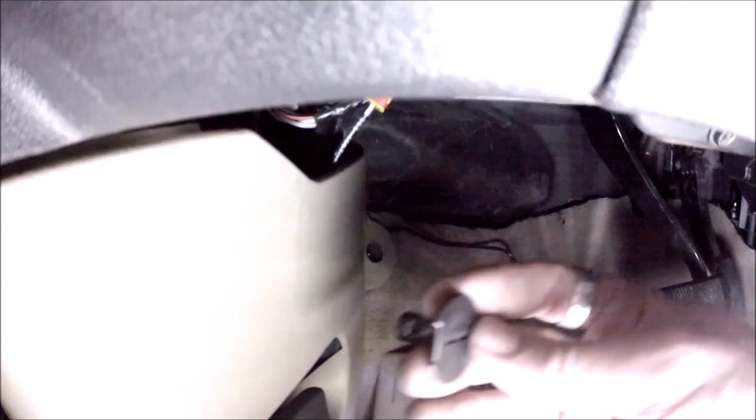Front sill is super simple to run along the bottom, just like the back. So just lift up on this, running along the lip. If you need to, take your trim removal tool and shove it up underneath there. And then, following up along through here, by the hood popper guy, same exact process, except there's one little tab right here, or one little plastic guy. It is all the way right here. Pull it off with your trim removal tool, and then that actually loosens this panel up to make it so much simpler to route the wire down through there.